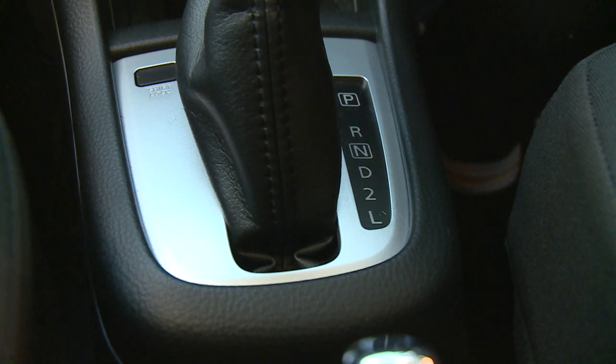Down from that we've got second and L — so these are your low gears. Those are selected when you need a bit more control. You might be going up or down a steep gradient, or towing something heavy, or if the car's a bit cold and you need to get up a steep driveway — put it in low and just use that until it warms up. It just stops the car from selecting the next gear up, which makes life a little easier on the transmission.